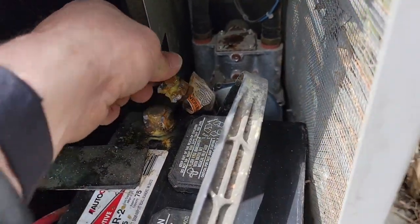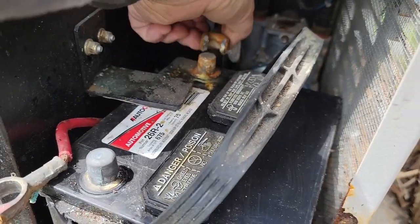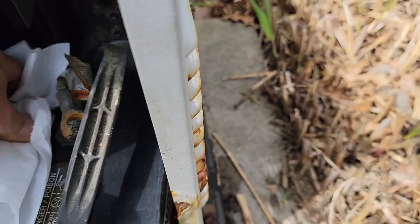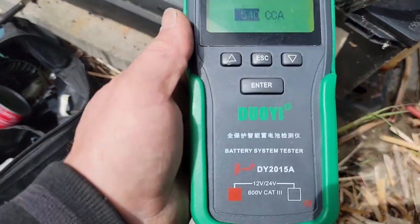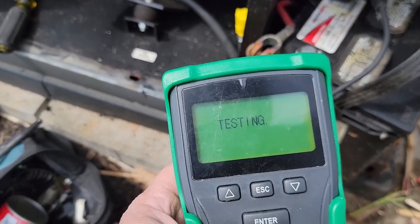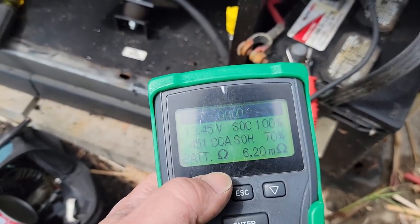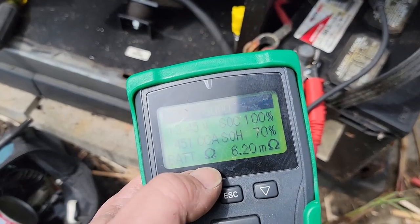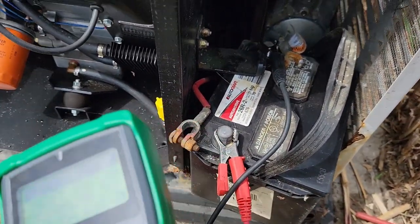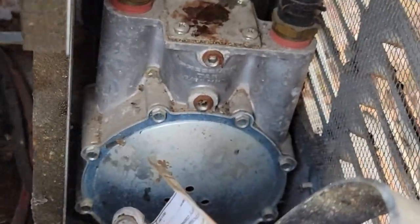Got this unhooked so we can do the testing, wipe some of that crud out. You can see how corroded the battery clamp was - well, it broke off, which is really wonderful. We got that off, we're going to have to put a new one on. I hate using those generic screw-down ones but that's about all I can get nowadays. Got the analyzer hooked on - testing at 540 cold cranking amps, coming in at 450, so it's 100 cranking amps below. It's at 70% - the battery's showing its age, but we're going to let it go for now. It's not our primary problem.